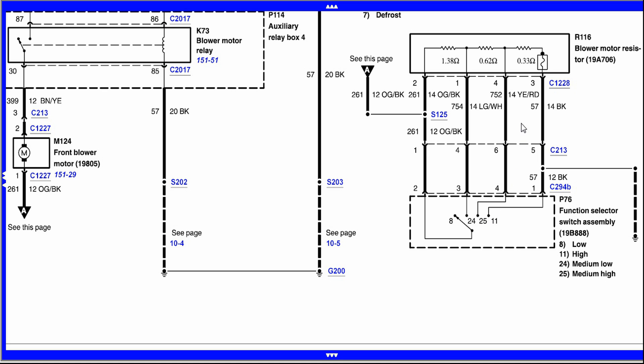On high — number eleven — you'll be able to see how it bypasses this whole circuit and resistance card, and why it still works even though the resistor card is damaged or has failed. On high, the ground comes in and back-feeds through to the function selector switch on pin eleven. When you flick it over to high, you're selecting number eleven, so it jumps through to there, goes up and over, and gives that perfect ground to the blower motor so it runs as fast as it can.